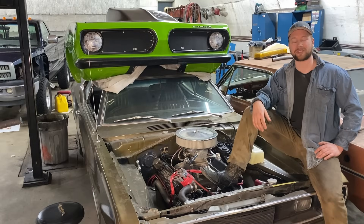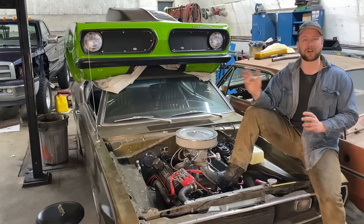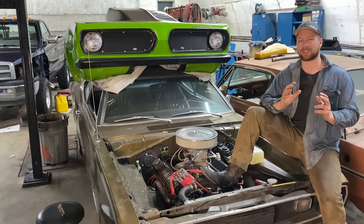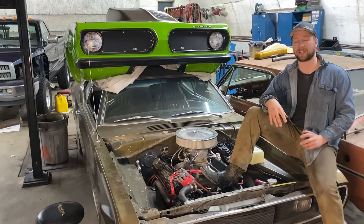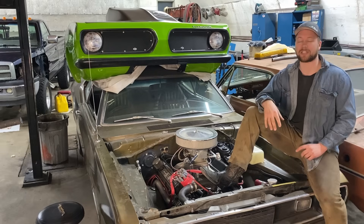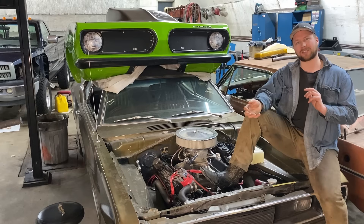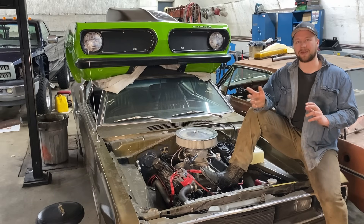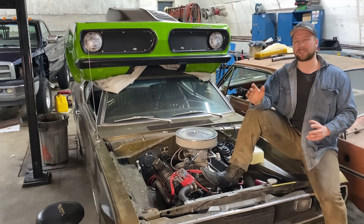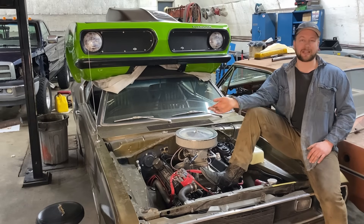That's it for part two of the 6.7 engine build series. I hope you're having as much fun watching it as I'm having building it. If you're not already subscribed, make sure you are so you don't miss the next entry where I modify the stock 6.7 turbo to work with this build — I do some custom stuff that I think will be a great addition, blending new technology with the older engine technology, giving a really broad power band and a usable exhaust brake, which I can still use in a compound setup I'll be building later. In the next video we'll also be putting the engine inside the truck with some accessory work to make the P-pump work with the block. There's also a related video on spill port timing on the injection pump to confirm I'm at an accurate 18 degrees of timing — it's part of the build series but as a standalone video. I hope to see you in the next video, thanks for watching.